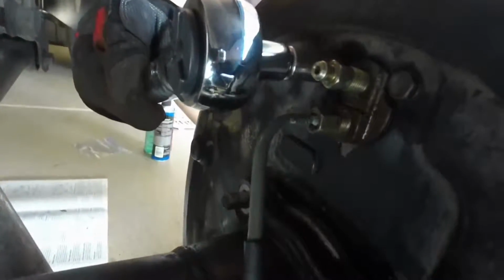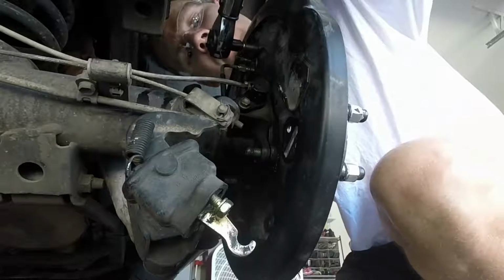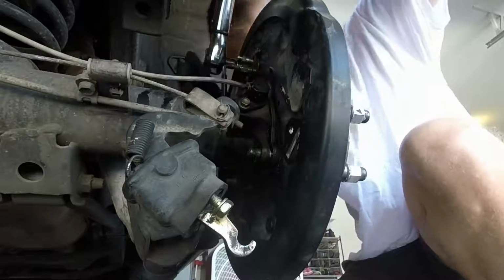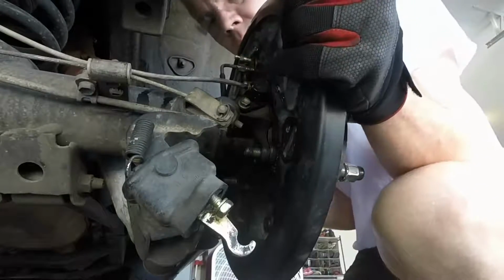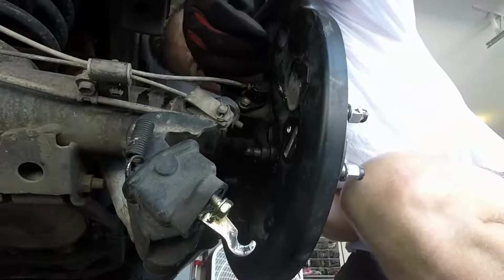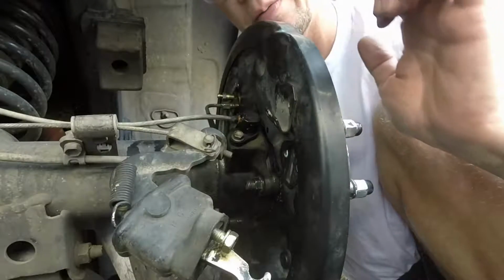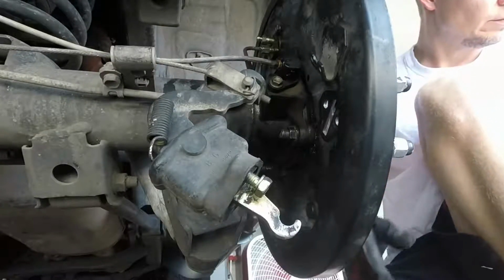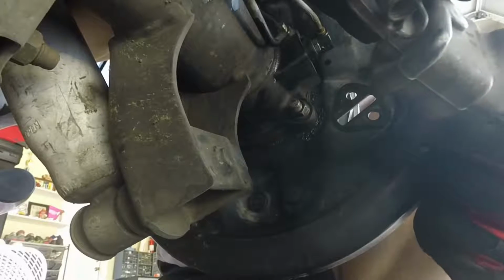Okay, you can go ahead and tighten these bolts to 84 inch-pounds for the caliper bolts that go onto the mounting bracket or the mounting plate. Okay, after tightening your wheel cylinder mounting bolts to 84 inch-pounds, you want to go ahead and just wiggle your mounting plate into the axle hub. Make sure it's flush. And then these nuts get tightened to 48 foot-pounds. Okay, you want to tighten these down in a crisscross pattern. That way it pushes the axle into the shaft evenly. And then you can go ahead and torque it down. You can put your brake assembly back on the mounting plate.